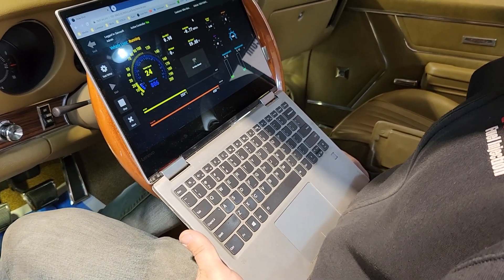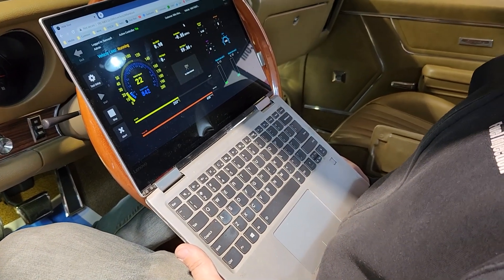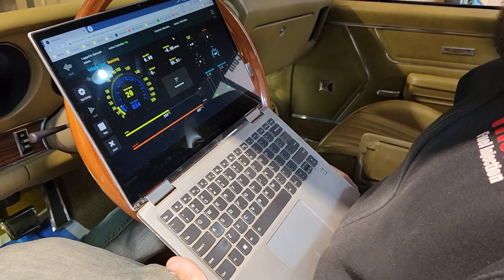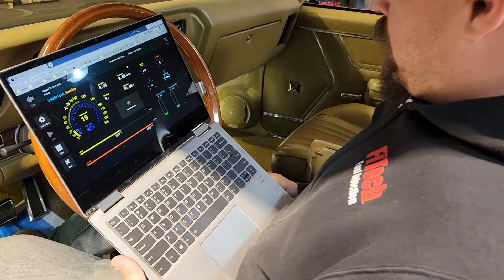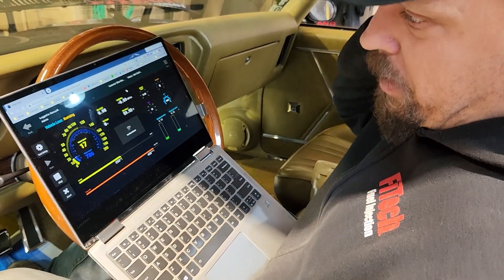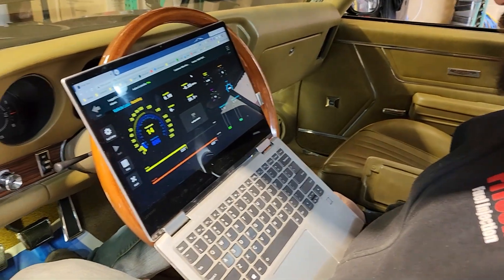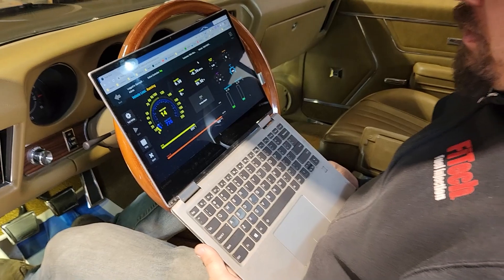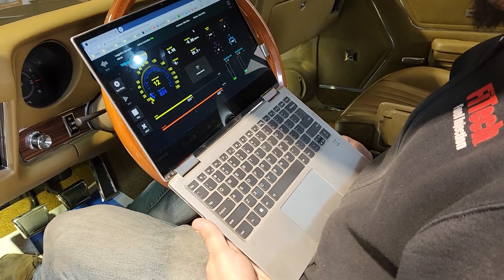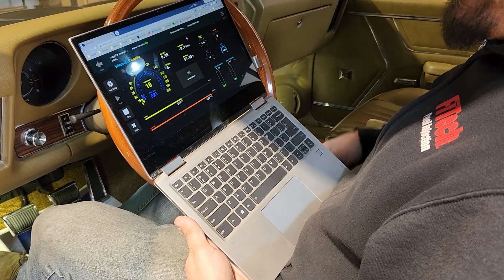It's just coasting down by itself. What gear do we test in? Because of your gear ratio, I'll probably do a power pull in third, just so I'm not up at like 140 miles an hour when I do a max rev. There will be minor transmission losses when we do the power measurements that way, but it at least keeps the tire speeds and driveshaft speeds in sane ranges. You're not going to be doing 6,000 RPM in fourth gear very often - you'd be around 130-140 mph if you did.